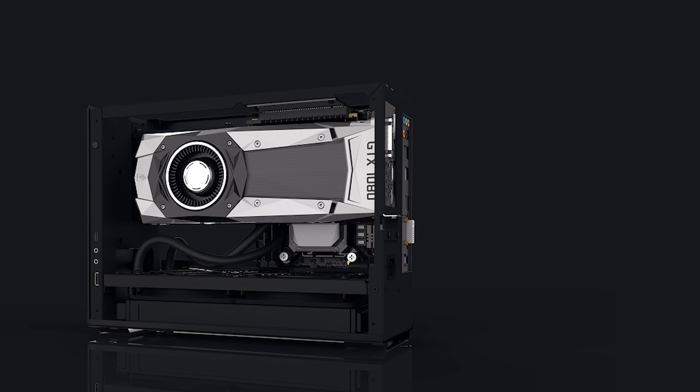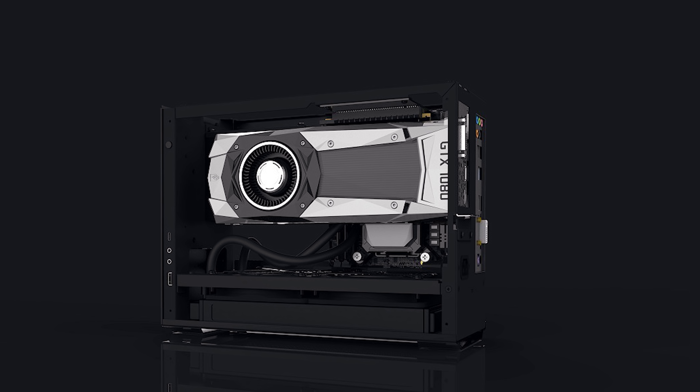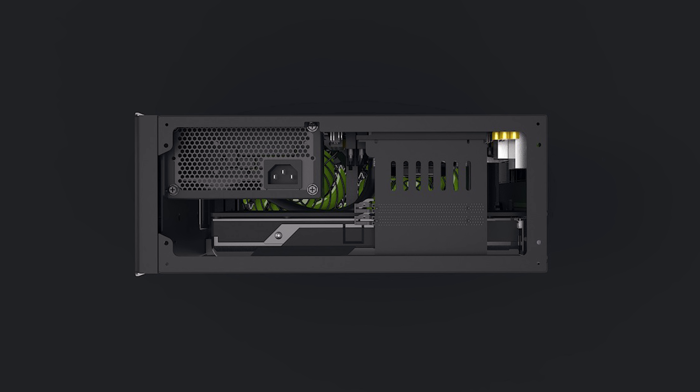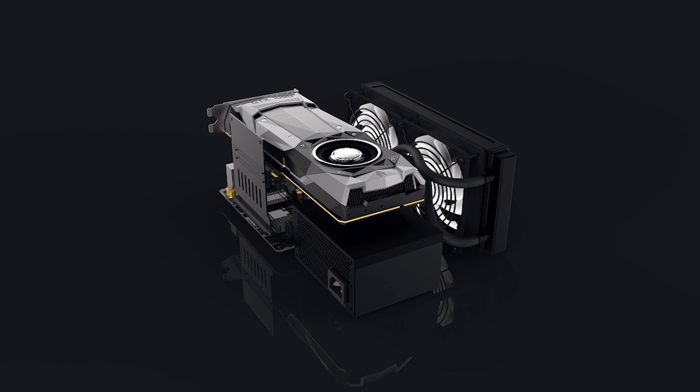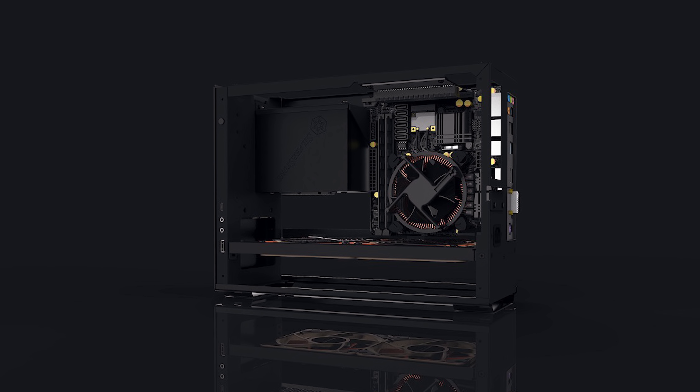It's still a sandwich design where the graphics card and motherboard are stacked in a parallel orientation, but in the C4 SFX both the motherboard and graphics card are facing the same direction. Because of this design, there will be a riser card for the PCIe slot — there may be two riser cards shipped with the case, one for a two-slot card and one that supports a two-and-a-half-slot card. If you're planning on putting a powerful system in this case, water cooling is pretty much a must. With air cooling for the CPU you're limited to a cooler height of 62mm, and even then you'd be pulling air directly from the GPU backplate, which is not ideal.